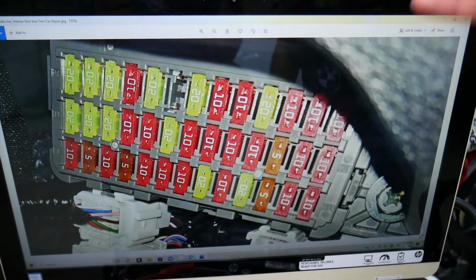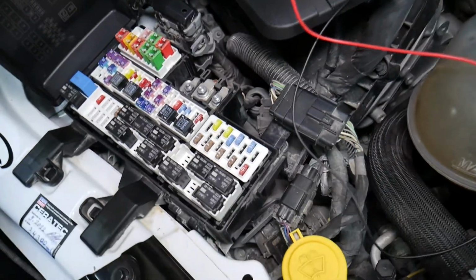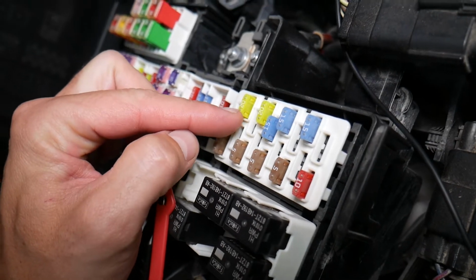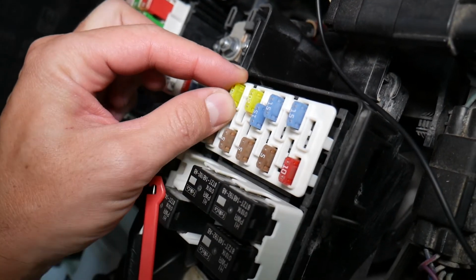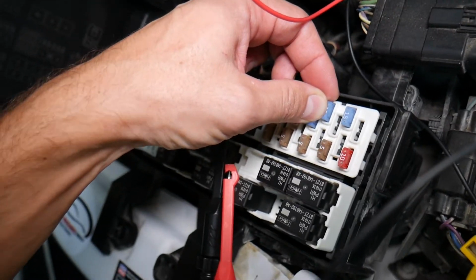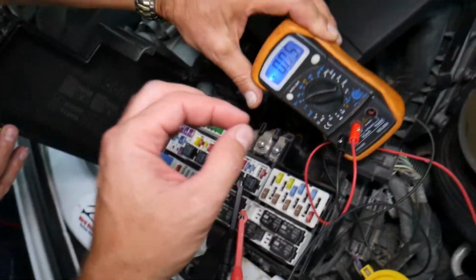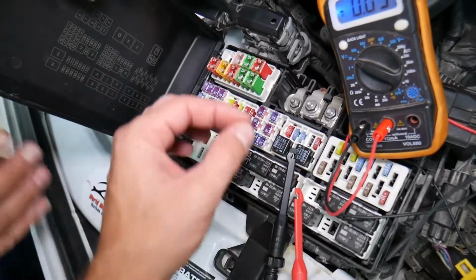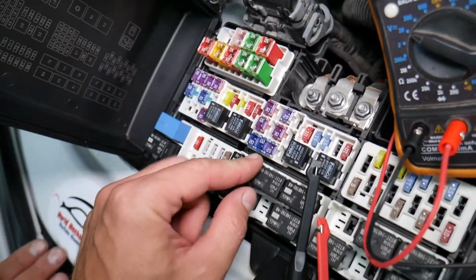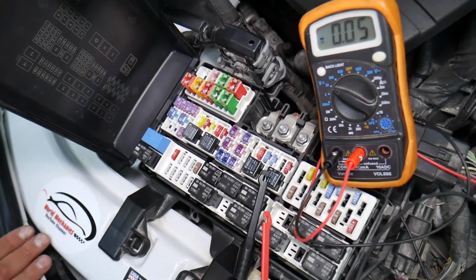But before we continue, guys, let's explain why it's important to test fuses and relays, that way you don't waste time and money. So let me explain why it's super important, guys, to test fuses. Often you can't see if they're burnt or good. Sometimes they may seem perfectly fine, you think it's a good fuse, you put it back in and you end up spending money and time on parts and problems that do not exist, when all you had to do was test your fuse, find out it's bad, replace it, fix your problem. So we will have a video on how to test a fuse, different kinds of fuses, and how to test relays, guys. We're going to put the link in the description of the video below specifically for that video.